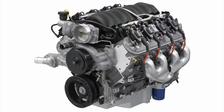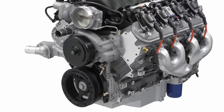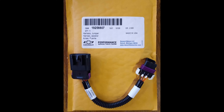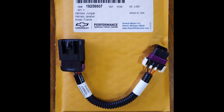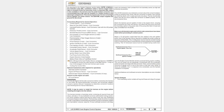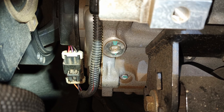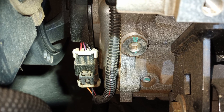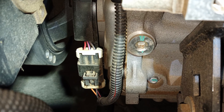The camshaft position sensor sits at the front of the engine on Gen 4 LS engines like this one. Out of the box, the E-Rod wiring harness came with the wrong connector for the cam position sensor, so they included an adapter cable they call a jumper harness. The instructions say the 6.2-liter LS3 requires the cam position sensor jumper harness to connect the main harness to the cam sensor. It was very easy to see which wire connected to which through the unwanted middleman connector, so we cut it out and soldered those connections directly. This is the final product.